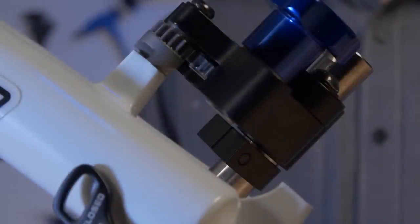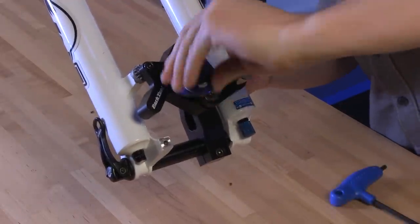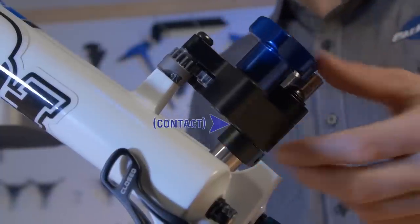Here you will find one of two scenarios. First, the cutter may be in contact with the upper post mount surface and there is a gap between the stop collar and the slider. This indicates the second post mount has a higher depth of cut relative to the first post mount already faced. In these cases, turn the cutter and face this second mount until the slider contacts the stop collar. Both post mounts are now faced and they are the same height.